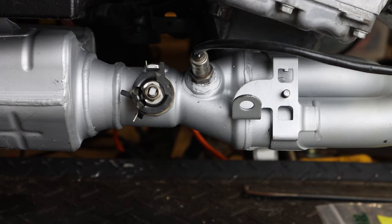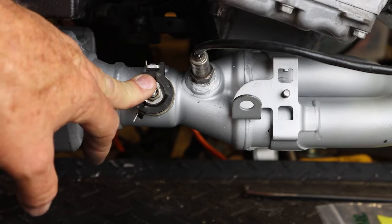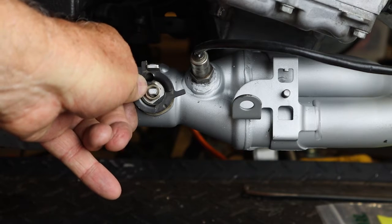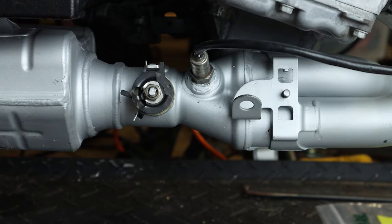And there's some troubleshooting instructions in the Haynes manual that will show you there's a wire jumper that you can plug into the wiring harness, and you can then test the exhaust servo controller so that it operates. It's supposed to travel in both directions, first this direction and then that direction. If it doesn't, then you're going to have to replace the servo controller, and I'm sure that's a very expensive piece.